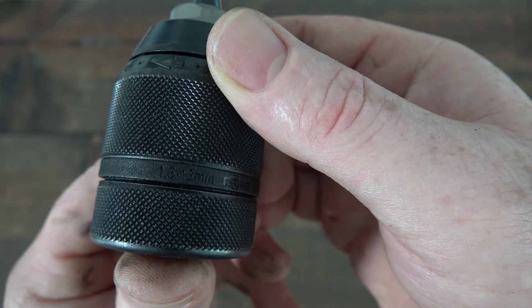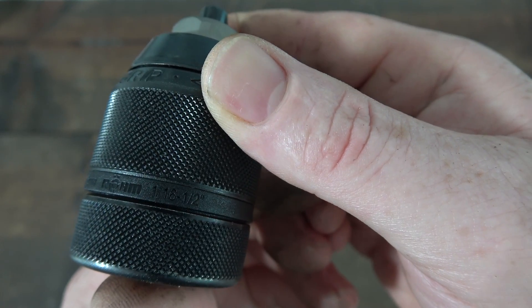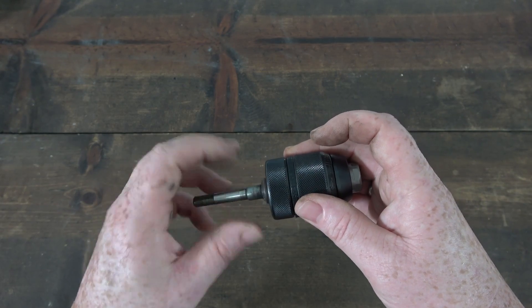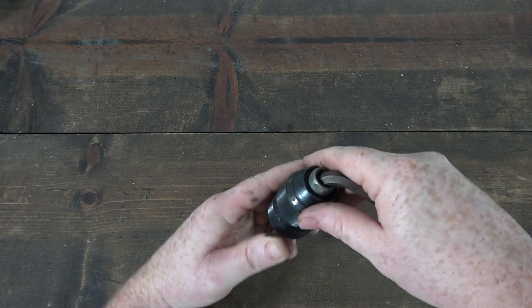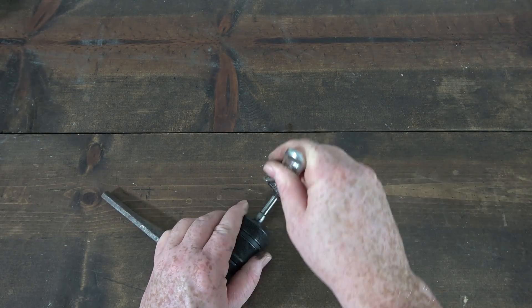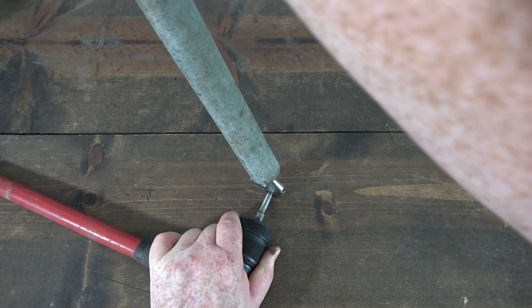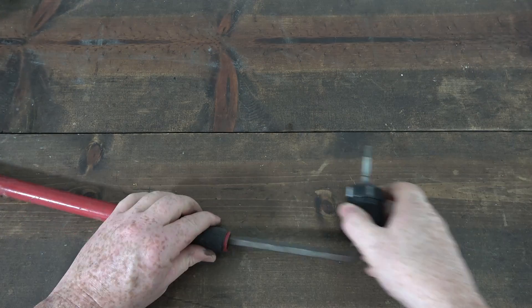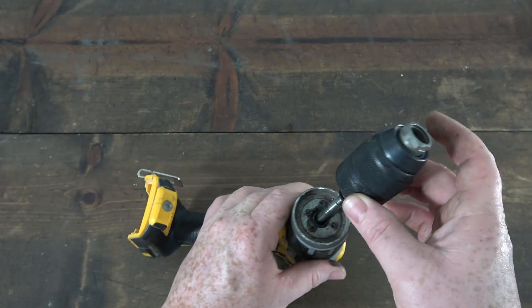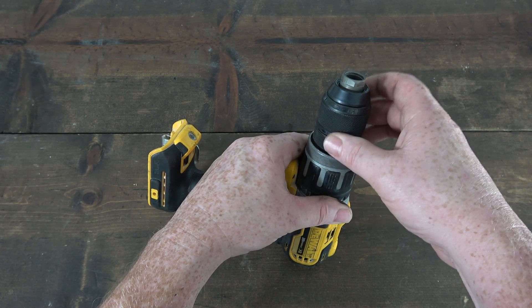You can see the specs here on the side, and at the very end that's a half-inch thread. I'm going to reverse what I just did and put the shaft back on the back of the chuck, thread it in, and get my Allen and adjustable wrench back on there. With the breaker bars, I'm going to put a little bit of torque on this — not too much, but enough. I got the spring back on the shaft before setting it in place, then dropped the shaft into the gearbox and twisted it, letting it find its way into where it fit.